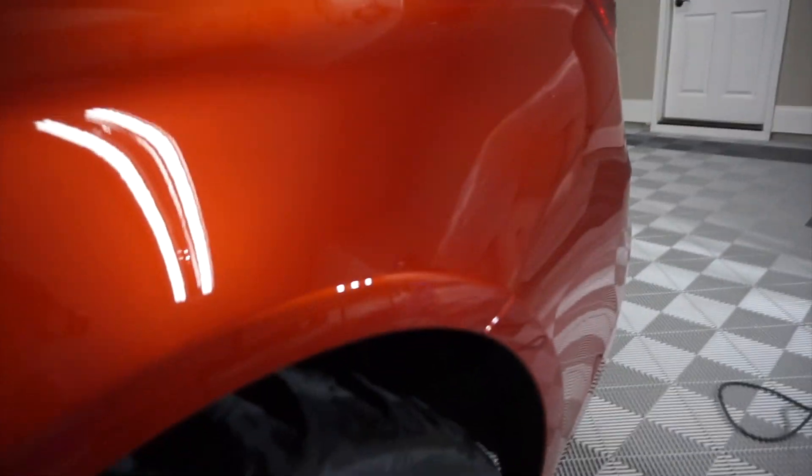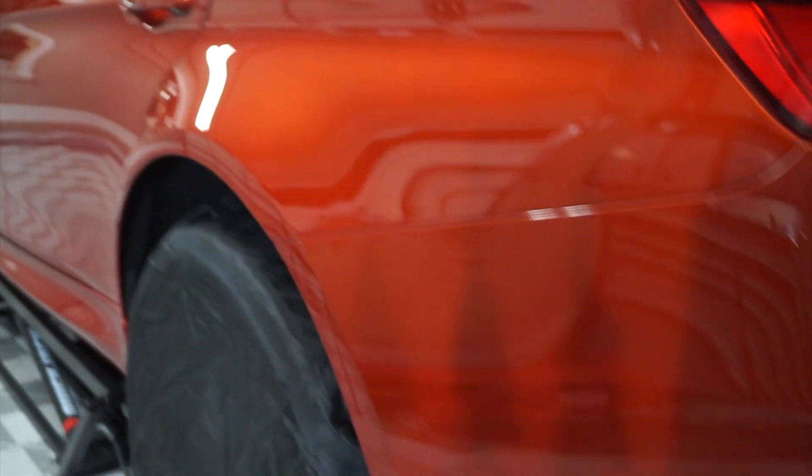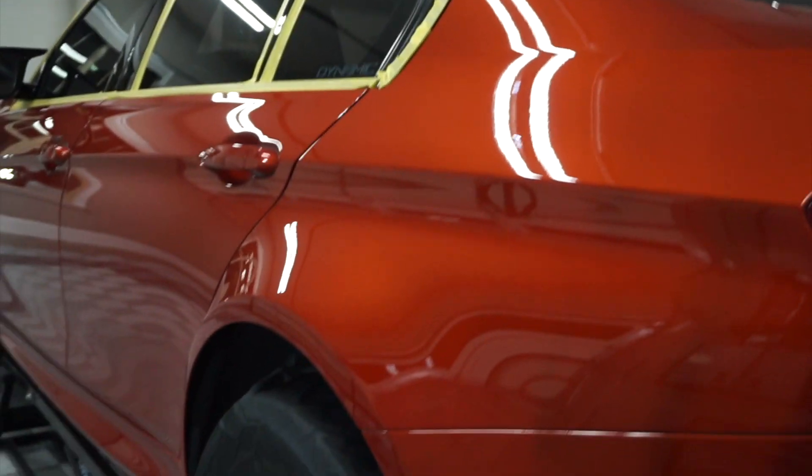All right, so let's have a look. A light refinement step followed by CarPro eraser just to remove any polishing oils. Bare paint — so this is our finished product. Looks amazing. High levels of gloss, really good clarity. That's what we want. If we stand back and just use the lights in the corner — it's so reflective. This is going to look its best. There's our bulb. So we're going to repeat that around the whole thing, and that'll be our refinement step.